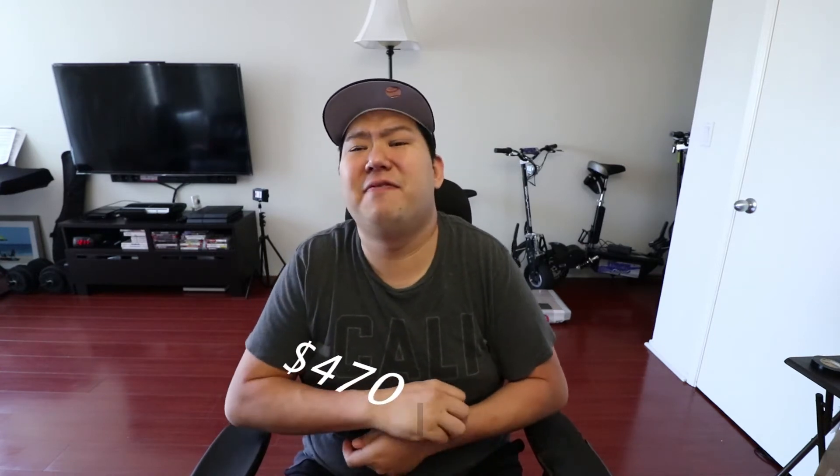Next huge upgrade — and this is kind of overboard — I got 128 gigabytes of RAM, the Hynix RAM, which is really good quality. I got the PC-10600 version, so it's 1333MHz RAM. The 2009 Mac Pros originally come with 1066MHz RAM, so it is faster RAM, though it really doesn't make much of a difference. That cost a whopping $470. I bought two 64-gigabyte packs — basically eight RAM sticks — four 16GB sticks per pack, totaling 128 gigabytes.